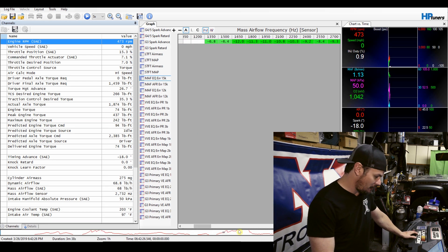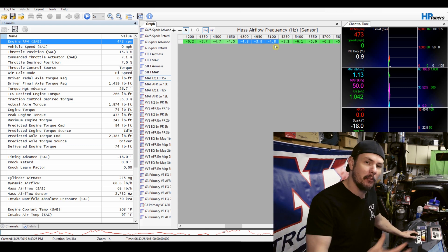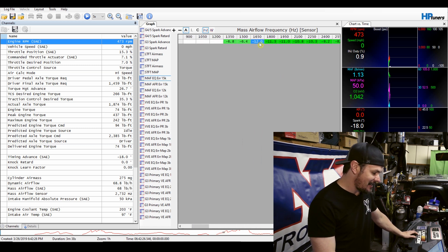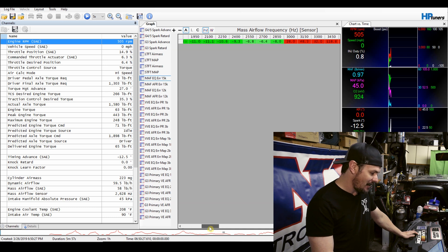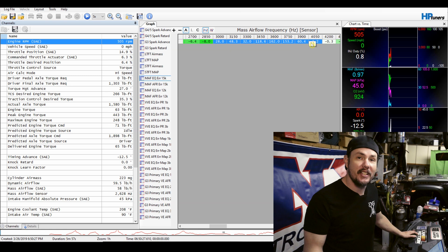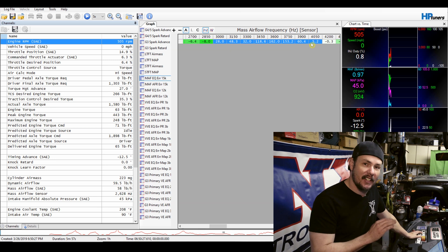After a change, we go into our next log — still about 10% rich, and it responds a little bit higher in the upper frequencies because up there we have more consistent air going through, so we're actually responding appropriately and lowering things a little bit. But down below we're still at that 10-plus percent rich around idle. And then this third one — just out of nowhere we're still reading 10% rich after yet another change, and then suddenly we go to holy cow, we're extremely lean — just mind-blowingly lean right through this section. And this is not true. This is just bad airflow on the mass airflow sensor.